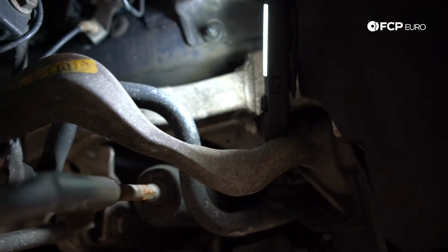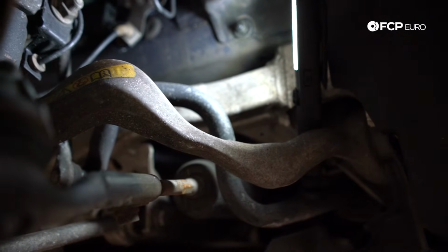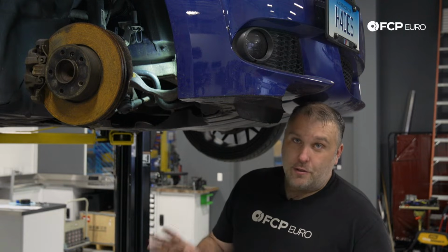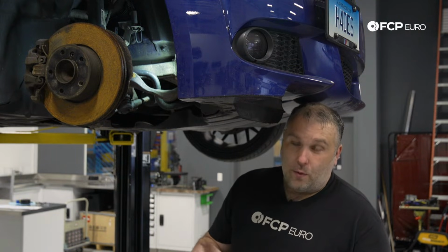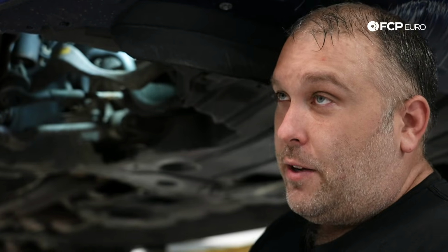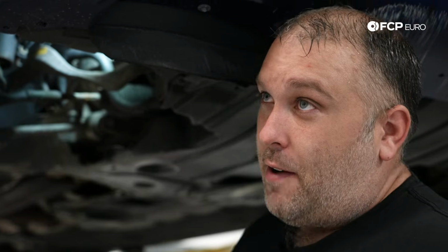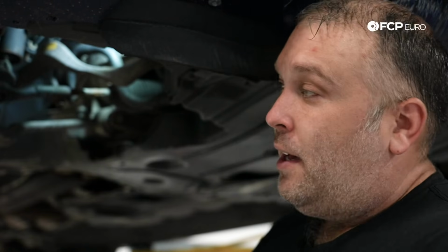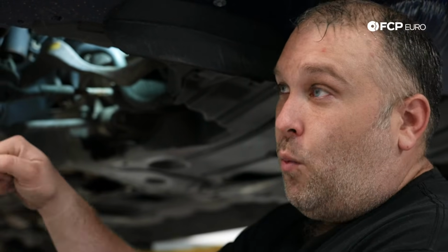And that could wreak havoc later on, because if the damage is repaired, some alignment shops don't actually know that you have to reset the steering angle for the electric steering rack to know that everything is now straight ahead. It will relearn on its own, but that's an electric steering rack specific issue. But most notably, your ABS will probably turn off and your stability control will probably turn off if you have to constantly drive with some kind of steering input to go straight. And that's more of a safety issue than anything else.